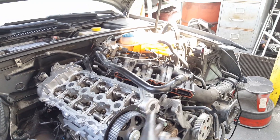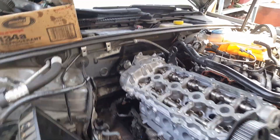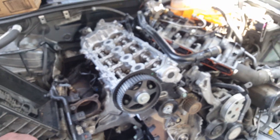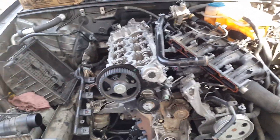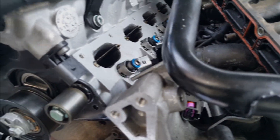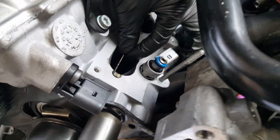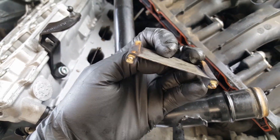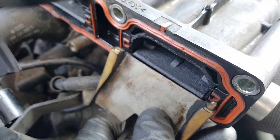What's next? Install the intake manifold, the ground, the little hose that goes on the bottom, the valve cover, the intake, and the turbo - but we're going to wait on the turbo because it's blown and already passing oil. So yeah, this is the update - that's how you install the head and the torque sequence. I'm waiting for the timing belt kit. Stay tuned and thank you for watching. Now on the 2.0 Audi or Volkswagen - see these little butterfly flat things here? They can go in two positions. These little tabs or ears go into holes on the intake. If you put them backwards, they will not go all the way in - you'll see it stays stuck about half an inch off. Flip it over and watch how it goes all the way in - flush. It's only one position.